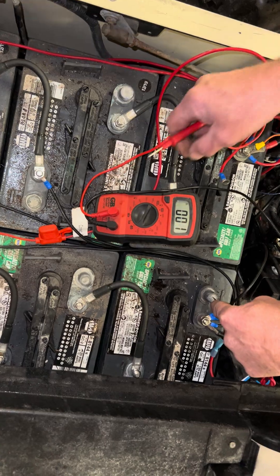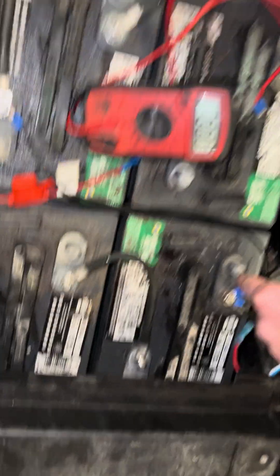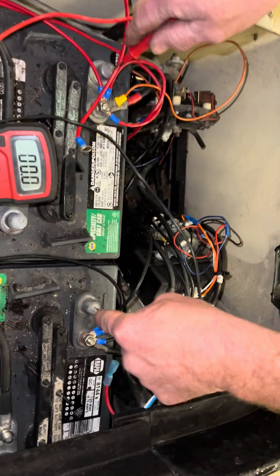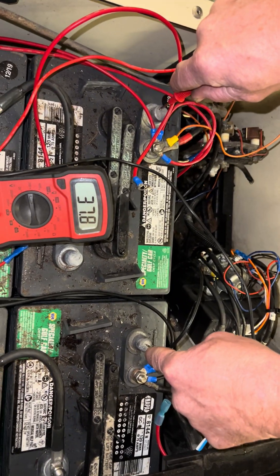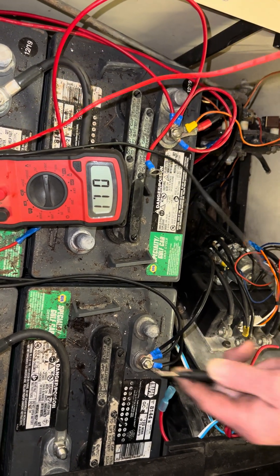When you hit the gas, we're going to set it for DC 200 — I had it on 600. Check the main positive, main negative: 37 volts. Hit the gas — don't drop below 31, 32 — so you're good.